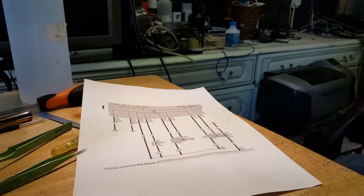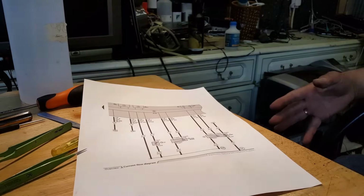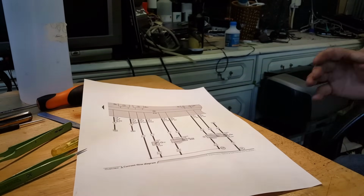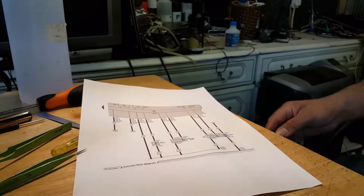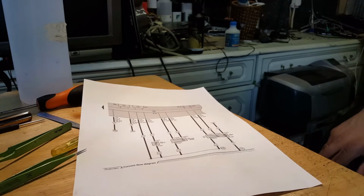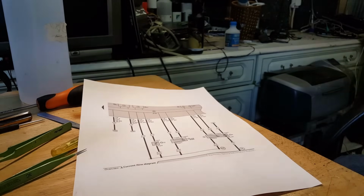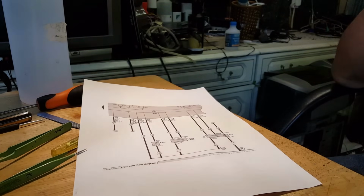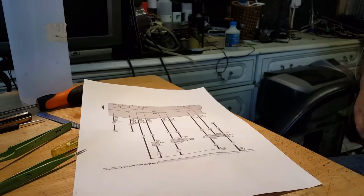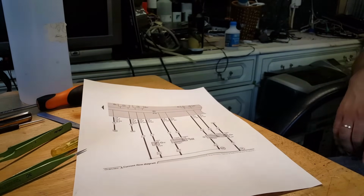Now, after tracing every single wire, I measured everything. I couldn't see anything wrong. The only thing I could think was if that cluster didn't belong to that car, belonged to another car, and maybe the wires input were wrong. One very important thing: when I was measuring the voltage reference, I was getting 2.4 volts. That's all I was getting. I don't think the 2.4 volts is right. I think we should get 5 volts or 12 volts. Because I don't have the diagrams or any data, I really don't know, so I didn't want to put 12 volts to it and just blow something.